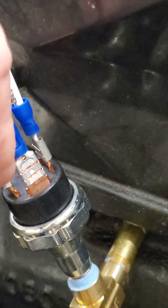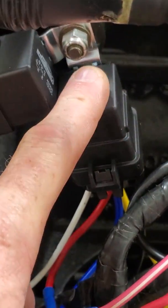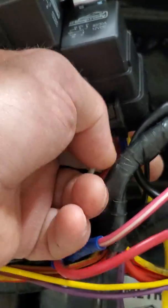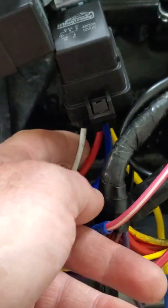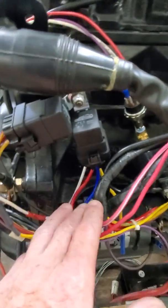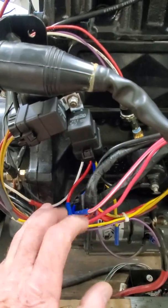That one says I, the red one is S, and the back one is P for pump. So the pump: your S is for your start, and I is for your ignition. So the way I wired it up was I took this relay — it's very similar to the starter relay. I purchased an aftermarket one and it has the five-wire relay. The white wire is the excitation for the pulling coil. The big thing to think about is we have to figure out how we're going to energize that relay.